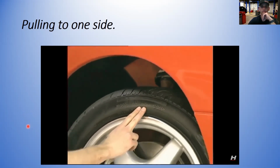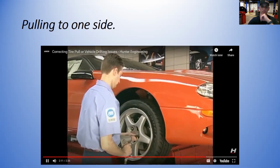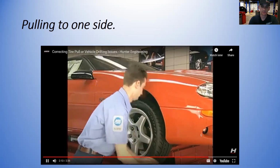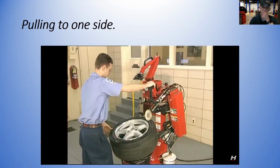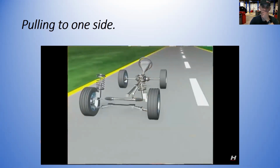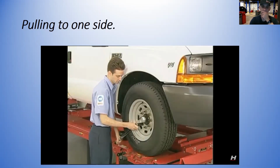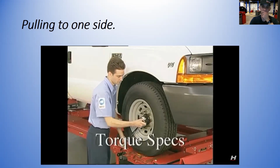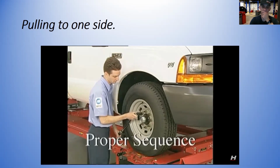When faced with directional tires or different size wheels front to rear, rotation diagnosis is not an available option. Instead, you must substitute tires at each wheel position and then road test. When the troubleshooting procedure is finished, always tighten the lug nuts to the manufacturer's specified torque and in the proper sequence.